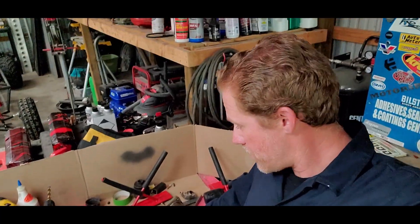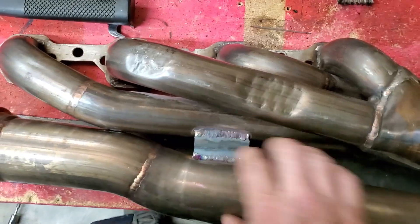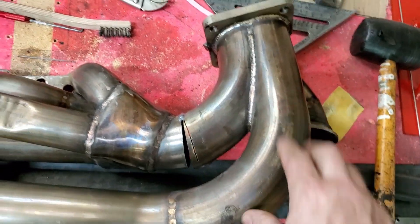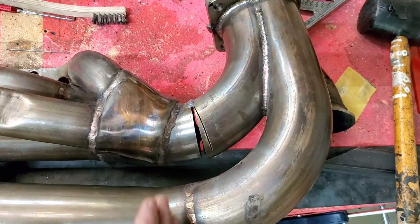Got the header out of the car. I also went ahead and cut out a little tab out of some stainless steel sheet metal that I had — let me show you real quick. Cut out that little piece there, went ahead and welded it in between this pipe and this pipe here to kind of keep this where I want it. This is where the crossover pipe comes from the driver's side over to the passenger side, so that's where I want that one to sit. I'm going to get this front section cut off — we're going to cut it here where it's been cut before and here at the weld, to keep the kickouts at the same position. Get that cut off the header, then get the headers installed back in the car, get the driver's side back in, definitely get the crossover pipe back in because things do tend to move around with the TIG welder.